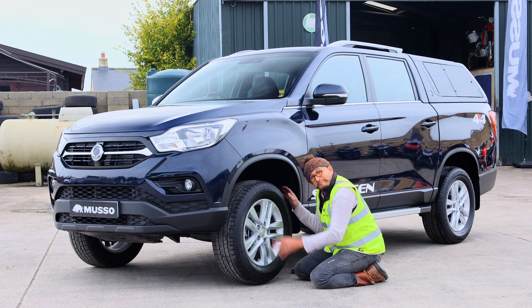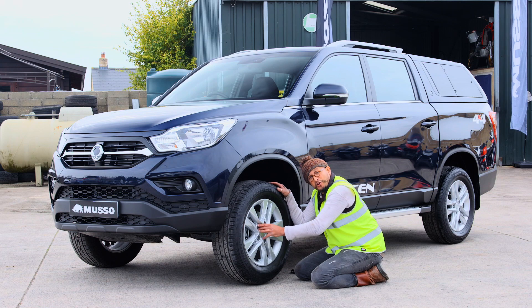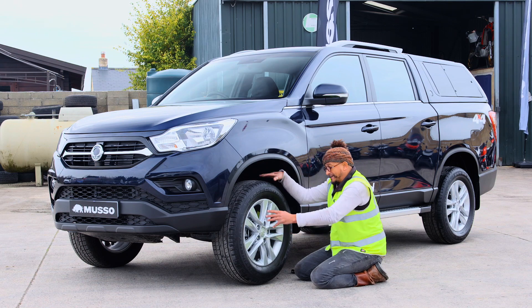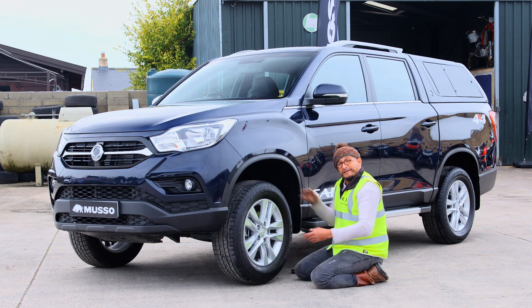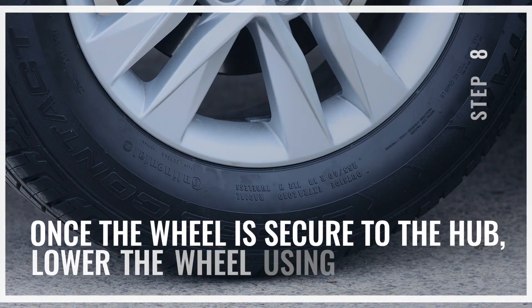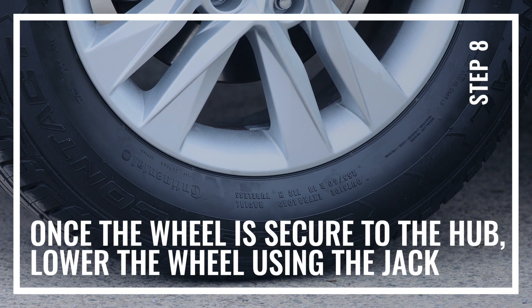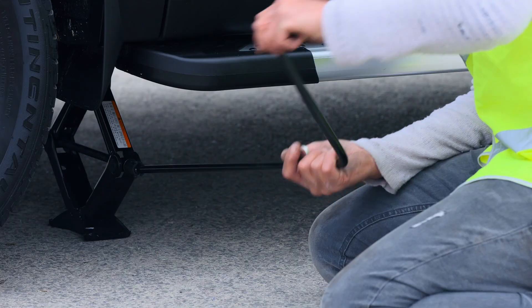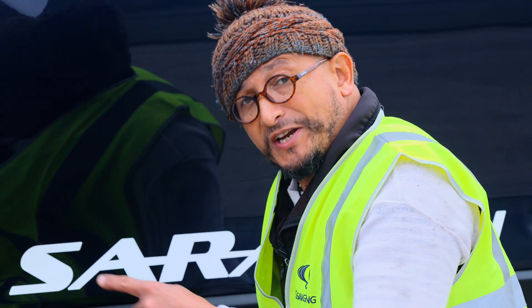The wheel is now basically secured onto the hub but the wheel nuts are not yet tight enough. We can't tighten them until we've got the weight of the car back down on the ground on the tyre and wheel, and we can remove the jack — and at that point and that point only can we start to tighten those nuts. Get your extension into the jack and then let the car down onto the ground again. Now we can proceed to fully tighten the wheel nuts.